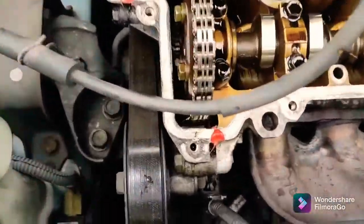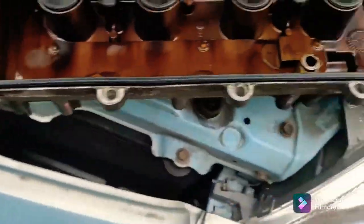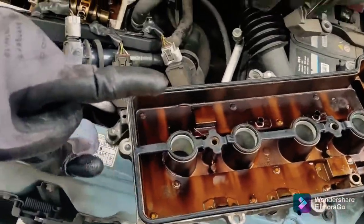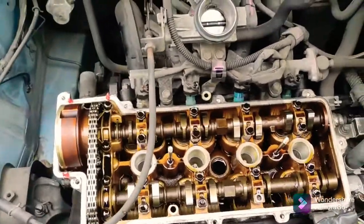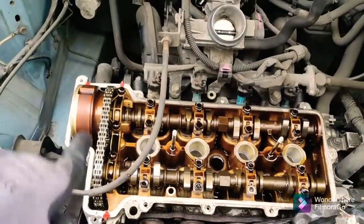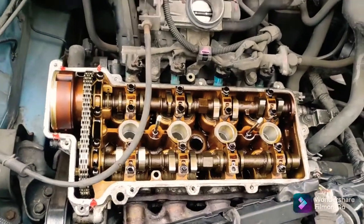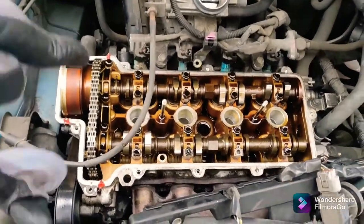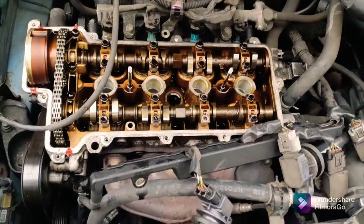There are the little dots marking where the crack lines are. I've placed the new gasket into the grooves. Now I'm putting it back in as it was, and I'll do the screws in a zigzag fashion — that way, that way, up, down, up, down all the way around — so that there's even distribution of pressure. Don't tighten the screws all on one side first, otherwise you'll end up with leaks.